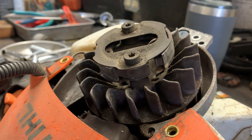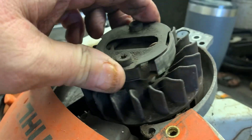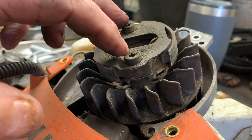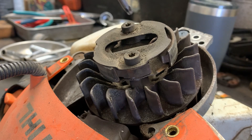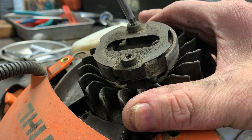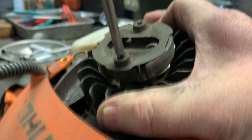What's up guys, More Medic One. If you ever work on one of these Stihl four-mix machines that have the clutch like this and it's got the T27 bolts instead of the 10mm bolts — they've done a running change on these — sometimes your little 12-volt rattle gun won't take these out. I'm just normally making sure my tool is on reverse and holding the flywheel with my hand, but they're just stuck like chuck.